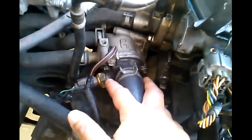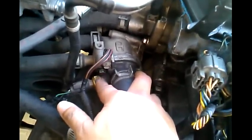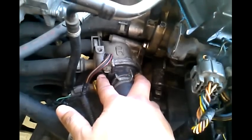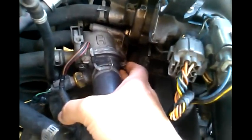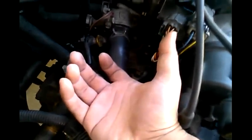To take off the thermostat housing, we want to take off two bolts. One is right above the cooling fan switch, which is right here. The other one is on the other side, down here. Keep in mind that when we take off the thermostat housing, coolant is going to come out, so we want to put a pan underneath the car to collect the coolant.